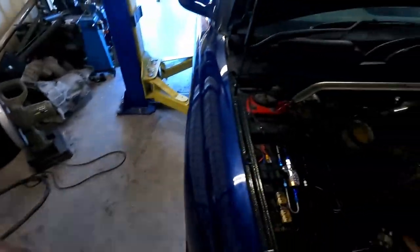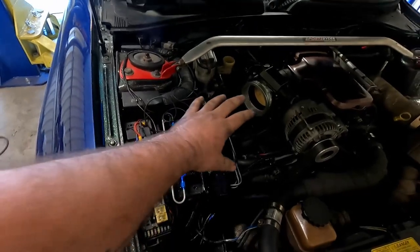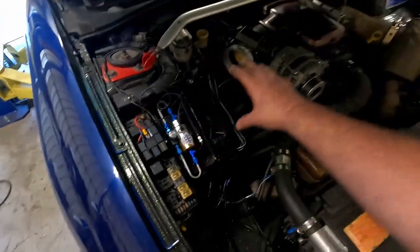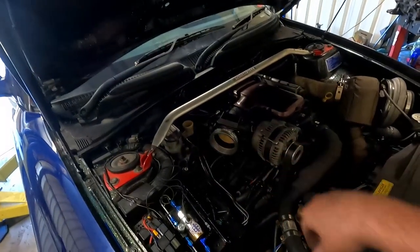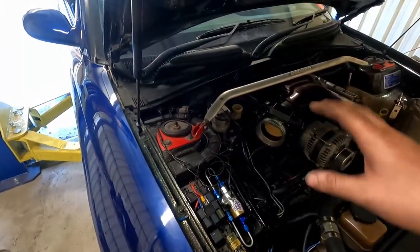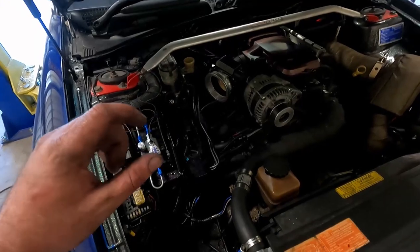Alright, so we've just gone and attempted to bleed up the clutch. We got the normal side of it bled alright, it seemed to be working fine, and then as we were going to bleed the slow release side with the solenoid activated, it's overstroked the slave and it's just pumping all the fluid out the slave. So seems like the transmission's got to come out so I can shim the slave away from the transmission, which is something I have known about for a little while.